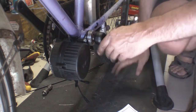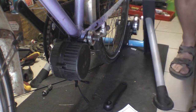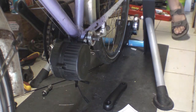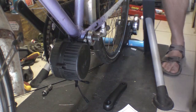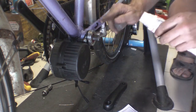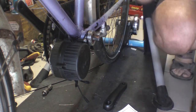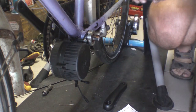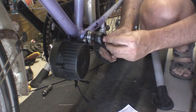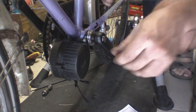There is a special tool you can get, but it's not particularly easy to get from your local bike shop — you've got to order it from China. If I have any problems I'll just take this crank arm off and re-torque it. 45 to 60 Nm. Put the other crank arm on — like so. Then we'll look at the battery.